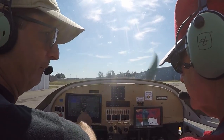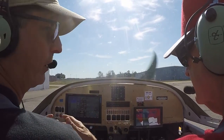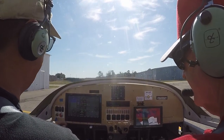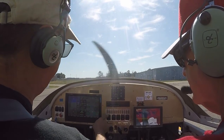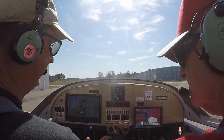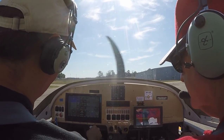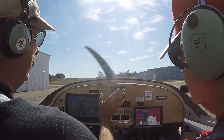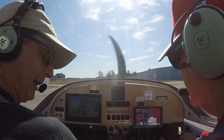This tells me that the spar pins are in, holding the wings in — or you can just turn around and look at them, or just notice that there are wings on the airplane. This is our trim. That green line is takeoff, so it is set to a lot of up trim right now. In this airplane the trim is electric; in a Cessna there would be a handle. We're going to push that back right around there — it goes really fast because of the autopilot.